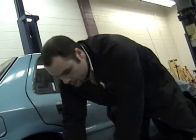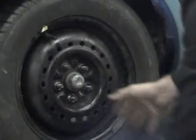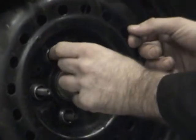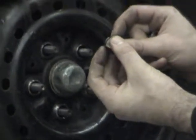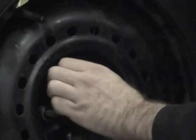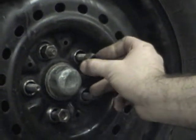I've successfully removed my wheel and can examine it, then reinstall it. Your instructor will have a task for you to complete while the wheel is off. I'm going to reinstall the wheel using the forklift motion, lining up the studs and holes and placing it all the way in. I'm taking my five wheel nuts — important: tapered side of the wheel nut goes in. If you put the wheel nut on the wrong way, they will come loose as you drive down the road. The tapered side centers the wheel on the stud since the hole in the wheel is larger than the stud itself.